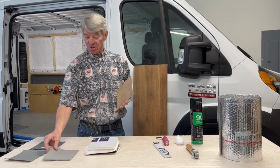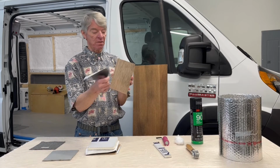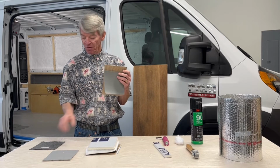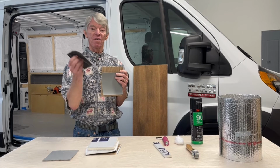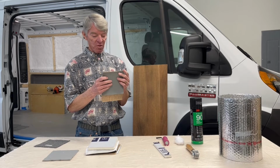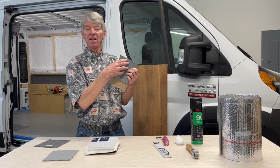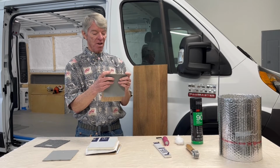The third material that I'm going to apply to this plywood is a marine vinyl. The marine vinyl is going to be used for the doors. If you use the cloth in the doorways and it's raining, the cloth gets wet, the plywood gets wet, and it's just not a good situation. So this waterproof vinyl is going to be used on all the doors. And so when rain hits it, it just runs off, it dries up, and you don't have any kind of problem.